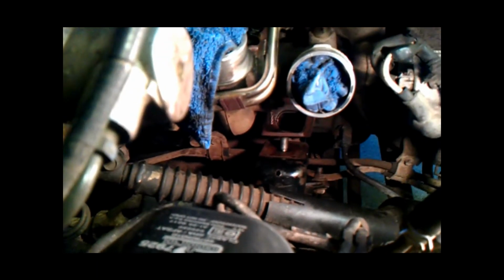As you can see, we're partway successful. I'm going to try and get this mount swapped, take this one out. The gearbox is supported on the jack around the corner. There's the jack handle and the gearbox is supported on my jack down there, and we've got the engine just held up on that crane. Down this side, however, because, as you can probably gather looking at all those tubes and pipes and the like, the access is pretty bad, so we're going to continue on, try and get one side out, and then I think it might be time for a break.